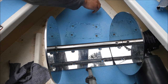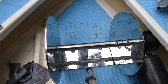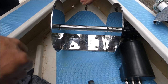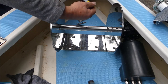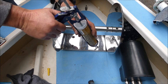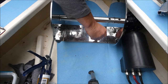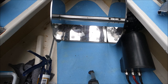We've got a really good application of silicon especially around those bolt holes and countersunk areas, and now we're ready to place the winch on top. I'm going to put some bolts through. I like to apply a little bit of silicon in the countersunk area too so the bolt drags some silicon through into the hole. All ready now to put the bolts in and tighten the whole winch down. I've only put them in partly to start off with to make sure they're all going to go in okay. There's going to be silicon on the underside that we'll clean up where it squeezes out from under the plate, but that's all ready to tighten down now.